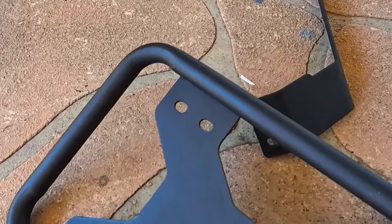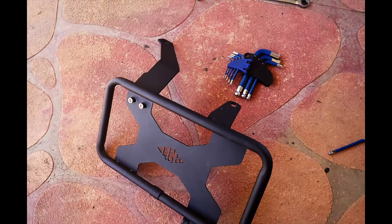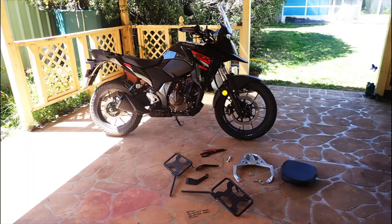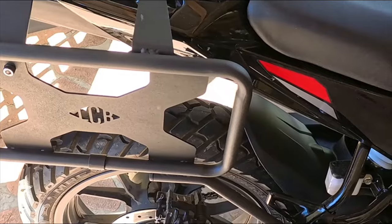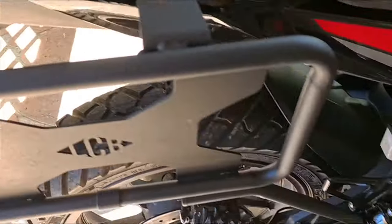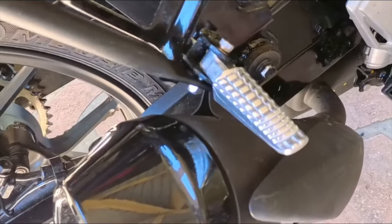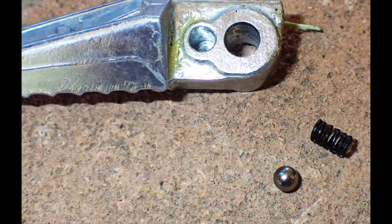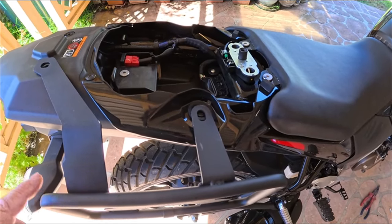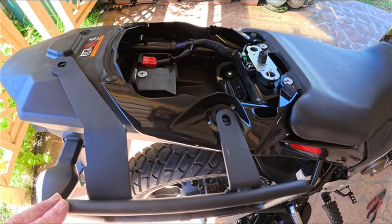You've got two holes at the side where you attach the bolts through the bracket. It was fairly easy to assemble but a bit difficult to put on the bike. Rather than threading bolts up here, the idea is to put the foot peg bolt in down here first just to hold it in place. No use tightening it right up at the moment - just a loose fit. Pull the other one out at the foot peg, put this one back in, then put the rack back on and go from there.